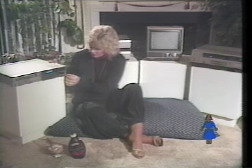Okay, tracking control. Now, this is really very important because once you know what tracking control is, you'll find yourself using it a lot. They have a tendency to hide it, so just look around. This one has it right in here. And look at this picture right now. Not very good, is it? Well, you can get rid of that simply by adjusting this little button here. You can get rid of the wavy lines or the horizontal streaks. See? Isn't that a lot better?